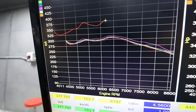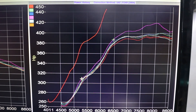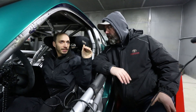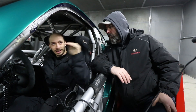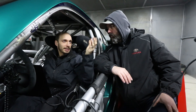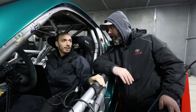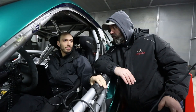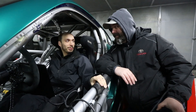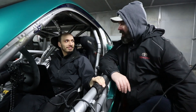If you look at the old engine there's a torque bump at 6500, so we're probably getting on the upswing of that bump right now. It will flatten out eventually. On the old engine we had that ceiling around 400 where we just couldn't get past it — hopefully with the extra displacement giving us more torque we can break through that restriction. Are we seeing 375 foot-pounds of torque? It's very meaty for a 4.2. Deliciously meaty. Let's get synthetic in it and push to 8200 rpm.